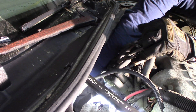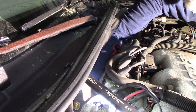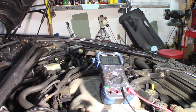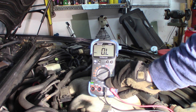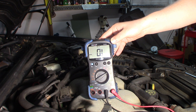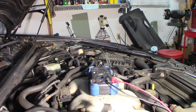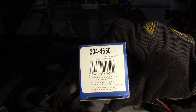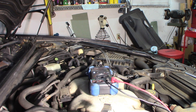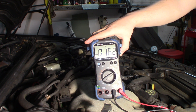Oh yes, this one just came loose — I'm so happy about that. Alright, I'm gonna have Chris hold this up so you can see. No continuity on the old one. I'm just gonna touch the ends of the leads together — continuity. Now I'm gonna go across the two black terminals — the same test I did before I pulled it out — and there's no continuity. Now let me get the new one and do the same thing. There's the part number for it — upstream — two three four four six fifty. I'm gonna go across the two terminals of the new O2 sensor: 16.2 ohms.